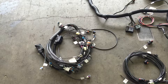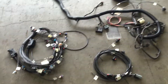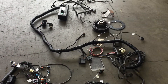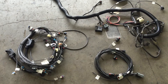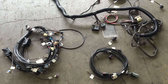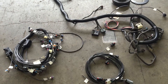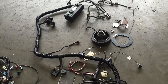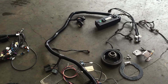We're just starting to get into more and more of these LS swaps into TJs, JKs, and whatnot. So here's a harness that we build — makes it really simple, all plug-and-play. You need to reuse the Jeep computer so you can have all the stock dash working: gas gauge, water temp, everything — you can save it and it'll all work. Jeep Speed Shop out.